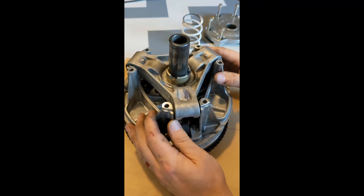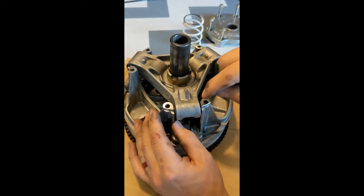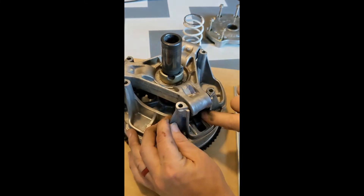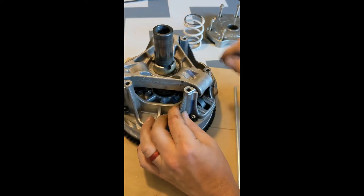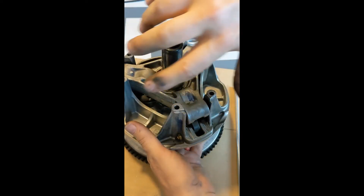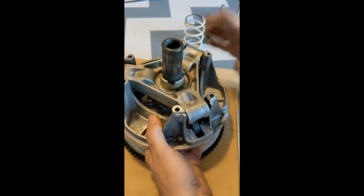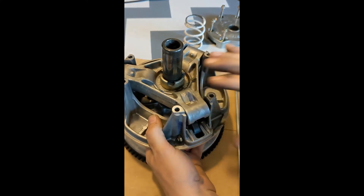The moving sheave and this triangular piece on top of it is called the spider. The spider has little plastic buttons — like glides — on each side of each piece. Those buttons ride against a smooth, slick area. If there's too much slop when I try to rotate my moving sheave, that will really mess up how efficient your clutch can be. You can have a primary rebuilt — I know Leon does it, and Mel Winnie would probably take a stab at it. There are also power sports shops, especially ones that do Polaris, that can do a rebuild.